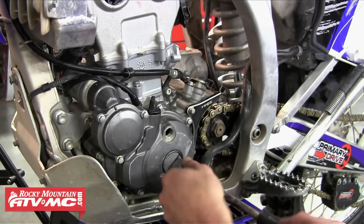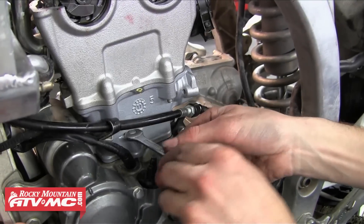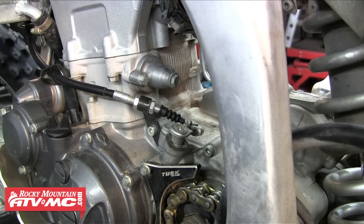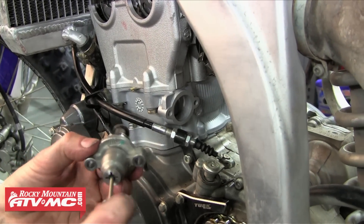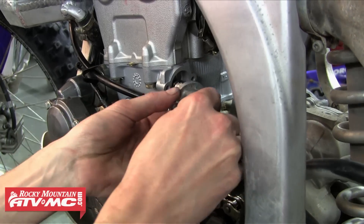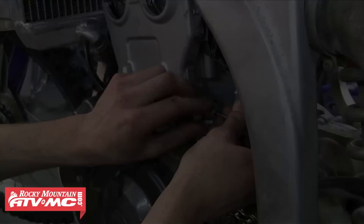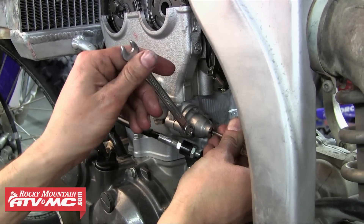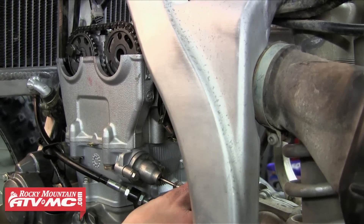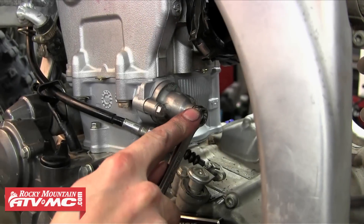After those have been properly torqued, we can go ahead and put those two engine plugs back into place and tighten those down. After that we need to install and tighten the small bolt on the left side of the cylinder and also the two nuts holding the cylinder to the head. Now that those are tight we can install the cam chain tensioner. To reinstall this tensioner we need to remove the bolt from the end and using a small flat blade screwdriver, suck the tensioner back into the housing by turning the screwdriver clockwise. Hold the screwdriver keeping the tensioner arm sucked up while you install the tensioner into the cylinder. Make sure you've got your new gasket on there, then thread both bolts into the cylinder and tighten those down. Once you've got the bolts tightened, simply pull the screwdriver out and the tensioner will automatically extend applying pressure to the chain. You can check your work by inserting the screwdriver and rotating it and then letting go — you should feel the tensioner spring back out. If it's been installed correctly, install that end bolt and tighten it down. Make sure your crush washer goes on with the bolt.